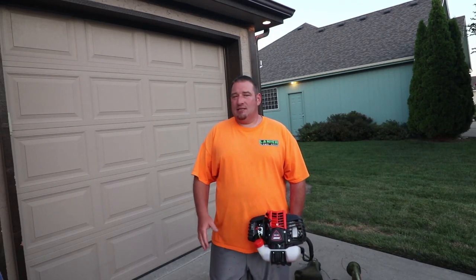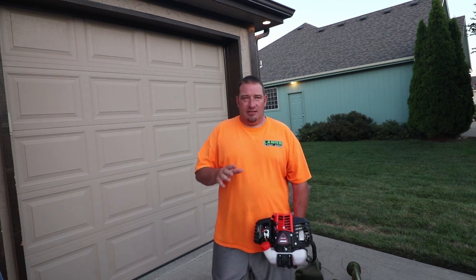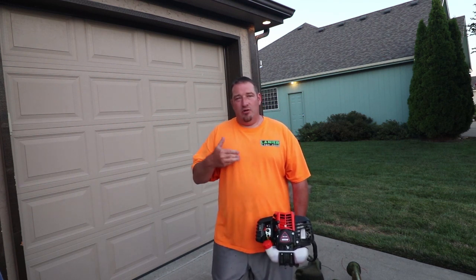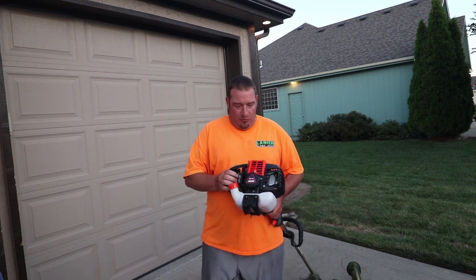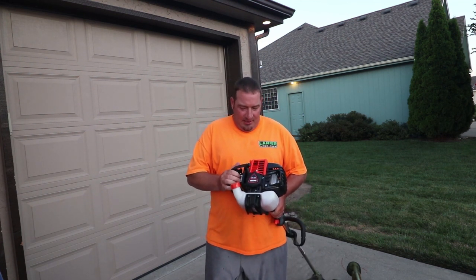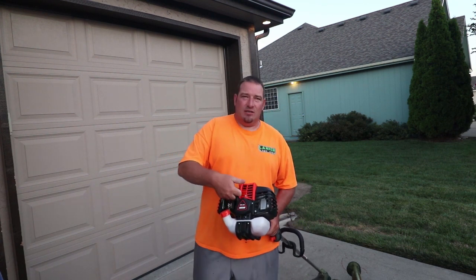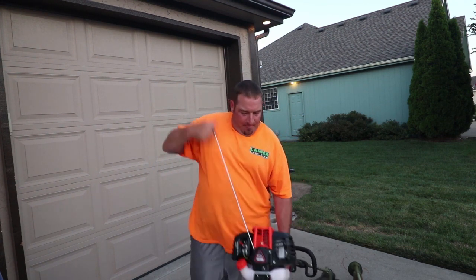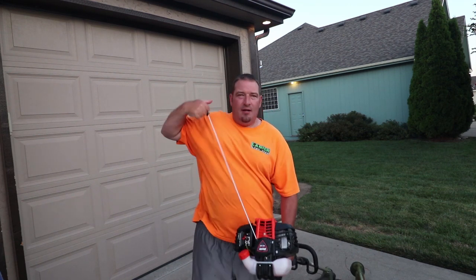So one thing we're going to show you on these is the cold start. These have not been started since yesterday, so it's been a full day pretty much since either one's been started. We're going to show you both of these easily start. All you do with the ECHO is we're going to prime it a couple times here. We're going to put it on choke. I'm not going to give this any gas whatsoever. And then we're going to take the choke off once it tries to start.